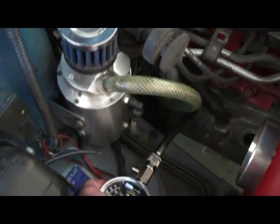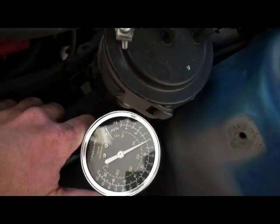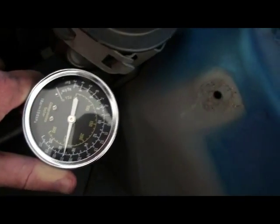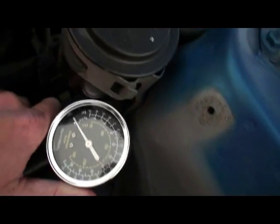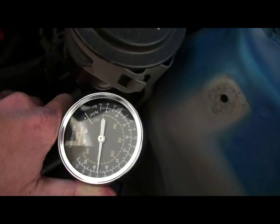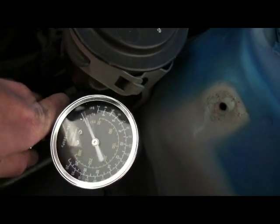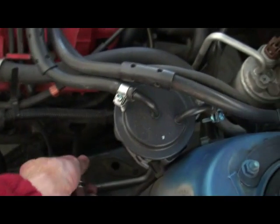Last but not least, number 4. Foot flat to the floor, Damien — go. That one's high: 168. I'll retest that one — 170 PSI. I don't know why that one is so high, but that's the end of the test. Looks like a pretty good motor to me — it's mostly within seven PSI, but this cylinder here I'll have to find out why it's reading so high. Thanks for watching.